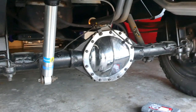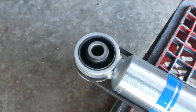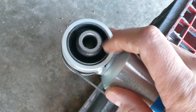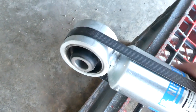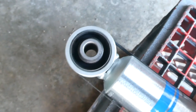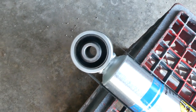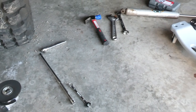We're just going to do the exact same thing on the passenger side — remove the bottom mount and upper mount and put your new shock on. We're going to grind it down before that so we can get it ready. What you do is take the shock and grind around here to make it nice and even — you don't want it angled or crooked. Just do one side, a little bit of grinding goes a long way. Just a socket and a couple of wrenches — that's really all you need.